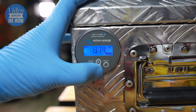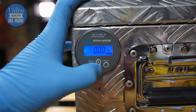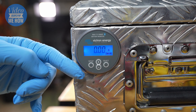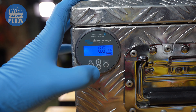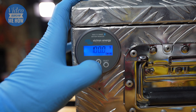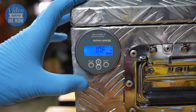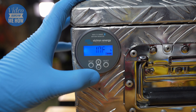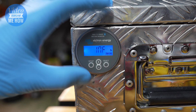Here's what it looks like once it's all set up. There's our current battery voltage — it's quite high because I've just had it on charge, so there's a chunk of surface charge there for this lithium battery. Then our amp rating, which shows a minus or plus depending on whether power is being drawn or fed in from solar or the RedArc BC-DC. Same thing in watts. This shows how many amp hours you've used through the system. State of charge again, and this one is pretty cool — it tells you how much time you've got left at your current usage, constantly calculating and accounting for power going in and out.